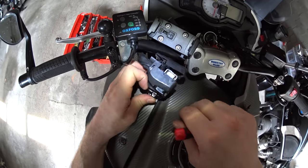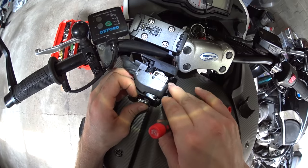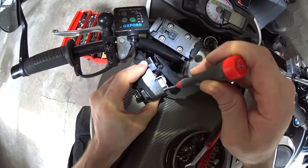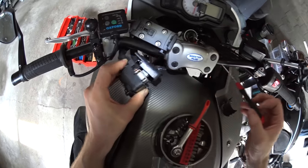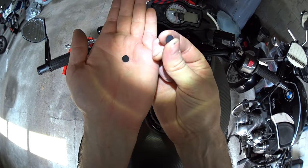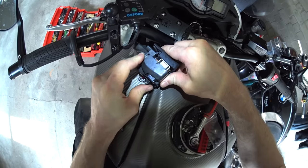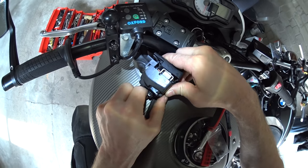Here's the switch mechanism - if I indicate to the left, the underpiece locks to the right; I push the button in the middle and it goes back to the middle. Indicate to the right, the underpiece locks to the left, and push the button it goes back. We need to stop that from happening - we need it so that when we go to the right it goes back to the middle on its own. You're supposed to put the sponge in between the moving part and the side walls. Flip it over and you can see the block moves and stays there - push the button and it goes back. So we need to get our little spongy bobs into these gaps here, and by the size of the holes we're going to need the thinner ones. Slot one in there, slot the other in there - then test it: the button switches but the block comes back to the middle all on its own.